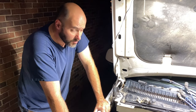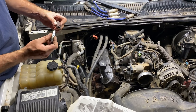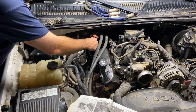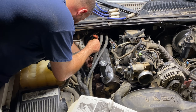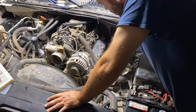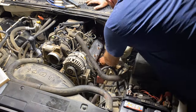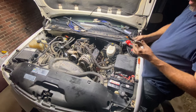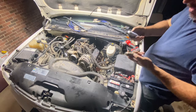I'm going to go ahead and put spark plugs back in it and go from there. I put the plugs back in using my old spark plug boot to stuff them on there, and tighten them up by hand. Spark plugs in and tightened to spec.